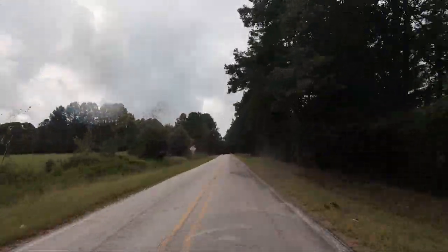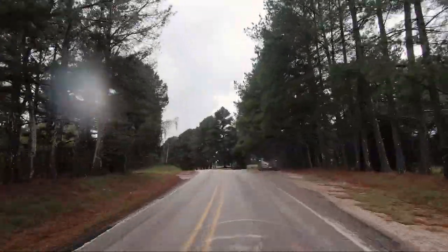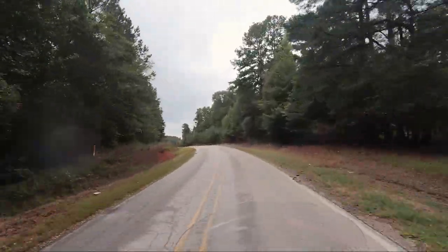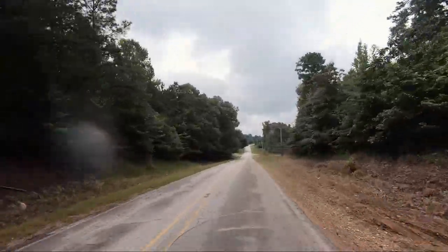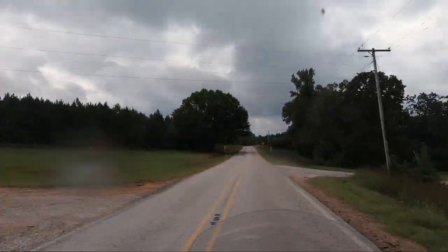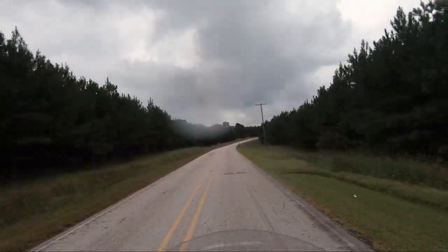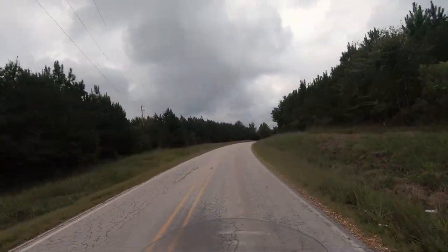This oil filter relocation and oil cooler was on my 14 Tri-Glide for about a year and a half, and it's been on this Tri-Glide 19 for about 2.5 years. So the hose is 4 years old. I didn't switch the hose when I switched it from one bike to another because I wanted to see how long the hose would last. It's been in below freezing temperature. It's been at 120 degree temperature. It has about 40,000 miles on it, and it looks like it's about time to change it out.